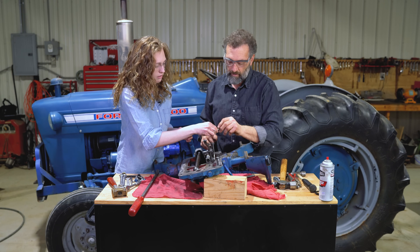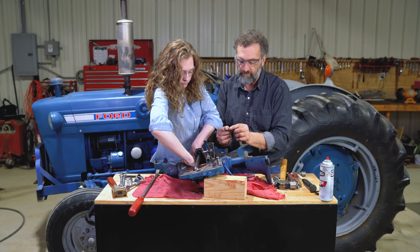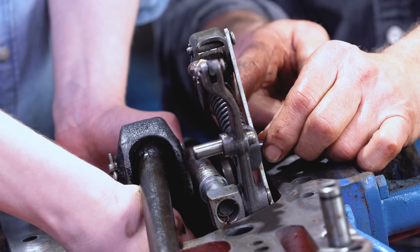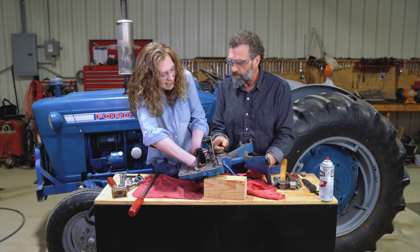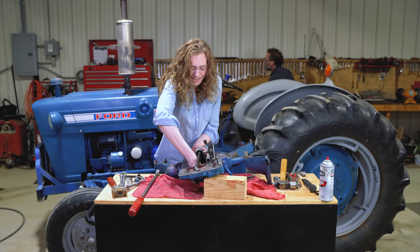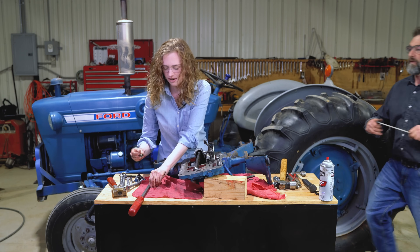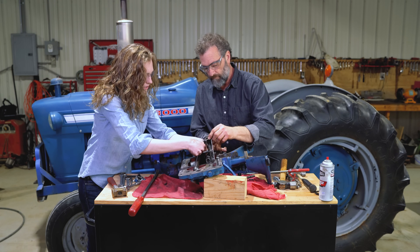Here's your new pivot pin. The pivot pin has a bullet head on one side and is flush on the other — put the bullet head in first to help get it going. Reuse the socket behind it to drive the pivot pin back in the same manner as removal. The old one's out and we'll just drive the new one back in.